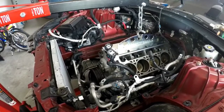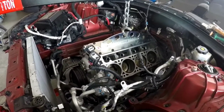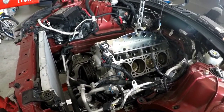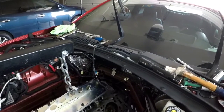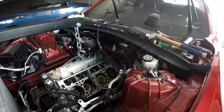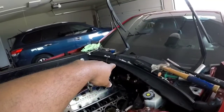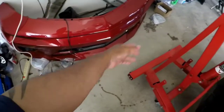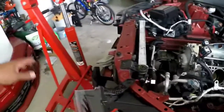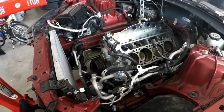These are really tight spaces to work in, especially since I didn't take the front off my car — I left the radiator and really just didn't want to fool with that. All my hoses are still intact and I shouldn't have an issue with them since they are removable. I have tools across the fender area, along with some bolts and studs that went between the transmission and the motor. Everything else is pretty much compartmentalized — bolts in bags, spark plugs, lifters, valves — and I've got the heads, headers, and all that stuff put up.